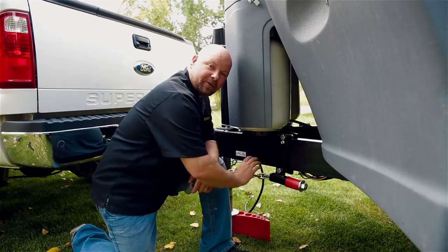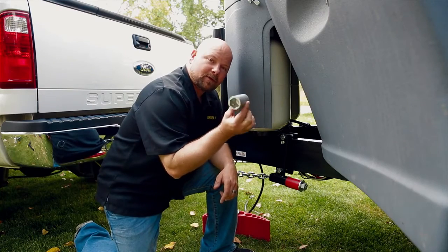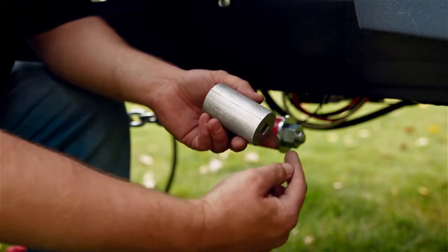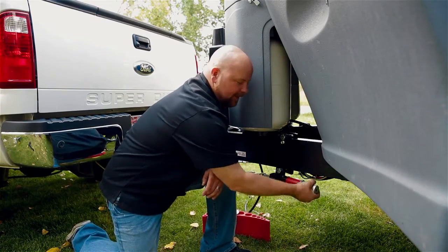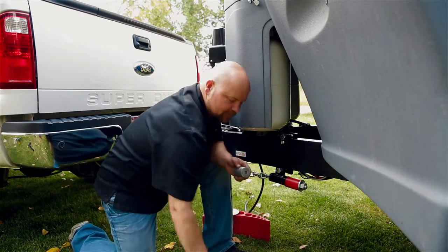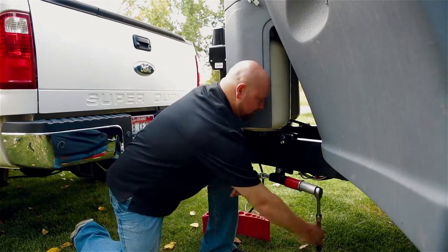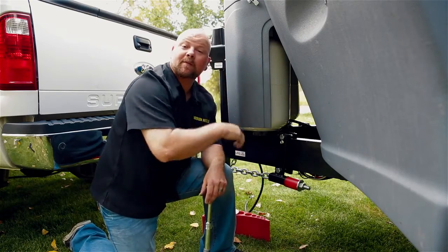At this point we're ready to set our tension on the chains. Double check that all your bolts are tightened down to specifications. Take the socket included in the kit and hand tighten to start. Each socket comes with a line on it to help you count rotations — each rotation counts for one thread. Rotate until it's solid and you can't twist it anymore. Then take a half-inch socket that fits in the end and give it three to four more rotations. That's four right there. Now we'll do the same on the other side.